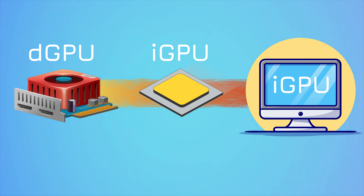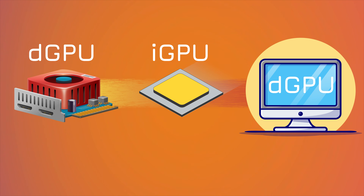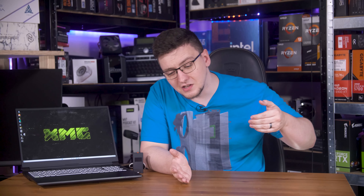Basically, the dGPU — your gaming chip — is connected through the iGPU, the low-power one built into your CPU, and Optimus will switch the video feed depending on what you're doing, and that gets shown on the display. For gaming, it passes through the dedicated GPU's output, whereas if you're just web browsing, it just turns the dedicated GPU off and only uses the iGPU. The problem with that setup is that your gaming chip has to pass its signal through the integrated GPU, which adds latency and requires the iGPU to keep running, sapping power from your gaming GPU and even your CPU.